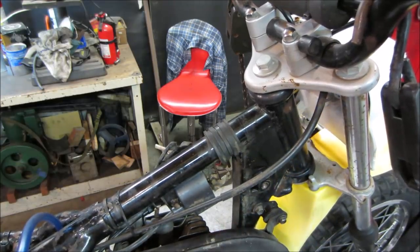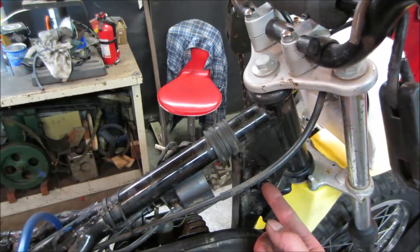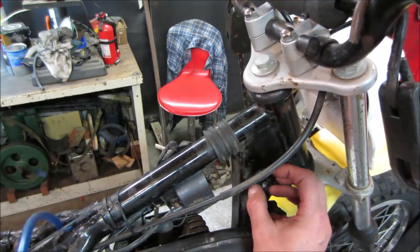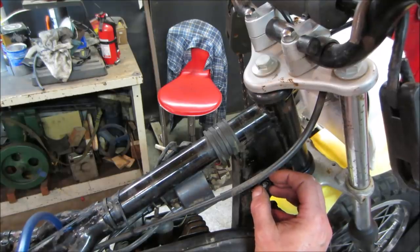See if that'll move on. It did some kind of weird turn. If somebody breaks off a bolt when they're tightening it, you have a fairly good chance of getting it out with an easy out. If somebody breaks a bolt off when they're trying to back it out, usually the threads are already so gummed up or rusted or corroded that, the reason the bolt broke in the first place is because it was jammed in the hole. You put an easy out in it, you're not going to get it.